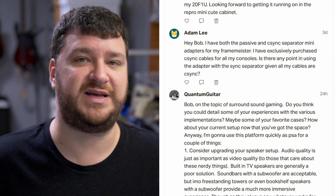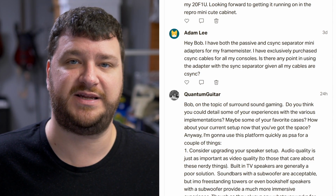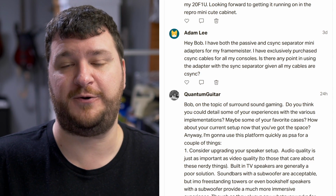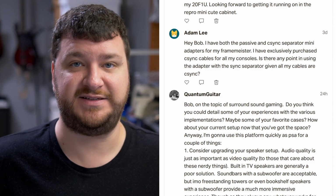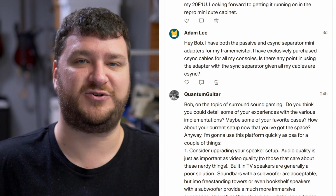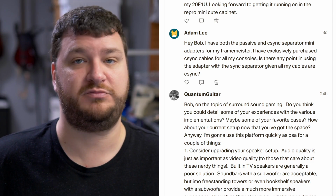And those were designed to fix other issues that were going on with consoles at the time. But now that we have all the knowledge of how these things output video and why there were certain problems to begin with, you don't really need any of those sync strippers at all, unless it's the specific scenarios that I talked about earlier, like if you're using an Extron Crosspoint with a PlayStation 1. But to answer your question, you don't need it at all.